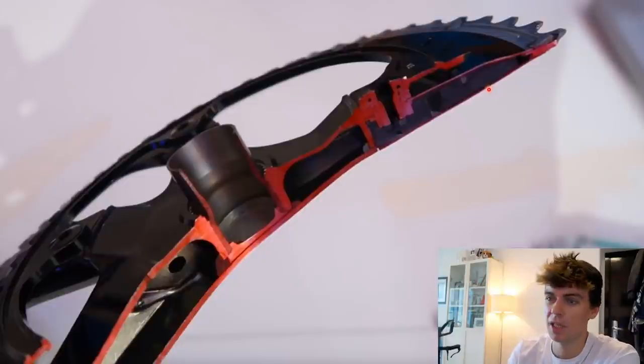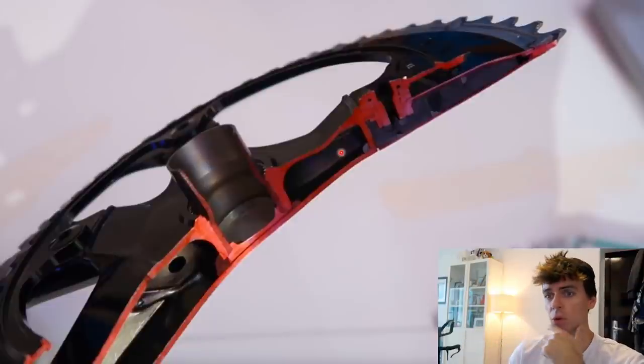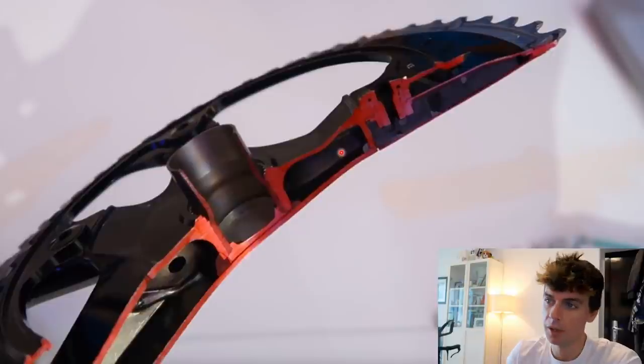They're not very stiff and the chain can pull them all over the place when the chain's on an angle. Yeah, that's basic construction. You can see adhesive here, and adhesive here. And I think the method of using adhesive is valid. It remains very light and very stiff, because you can make the crank very broad and give it good thickness. High second moment of area, it's called, but remains light.